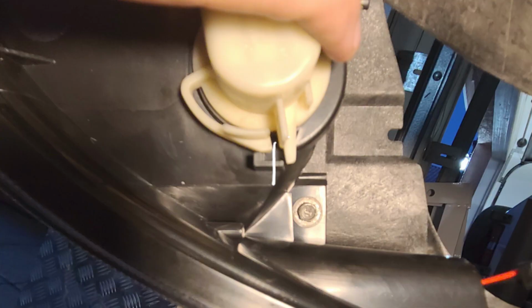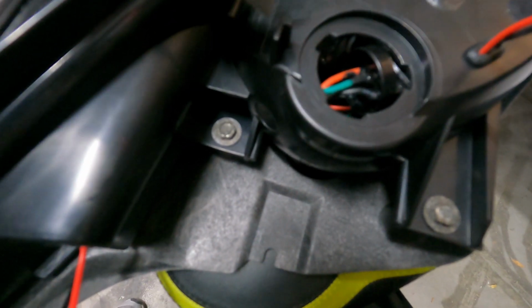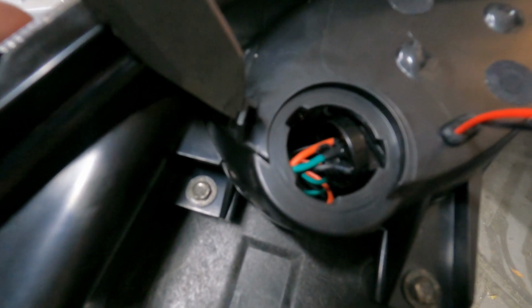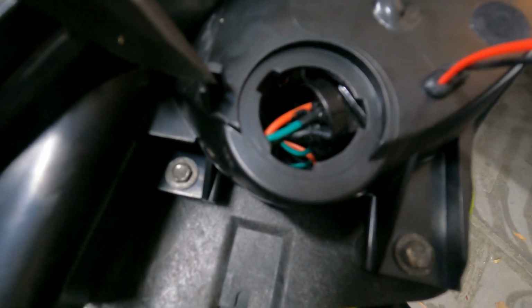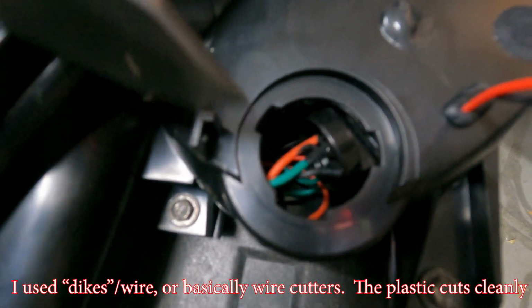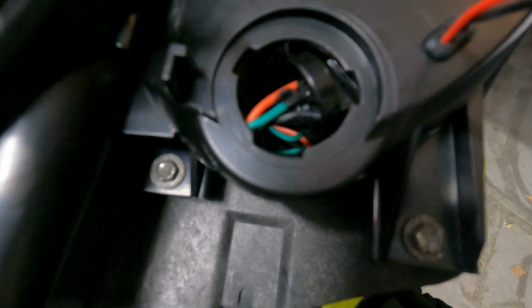So it looks like, obviously they're not going to be able to change this mold because these injection molds are done. So the fix for this is probably going to be a little mod, and you're probably going to have to cut this down probably about right here. So I'm going to do that now, and I'm going to confirm with a photo once that clicks in, but it's probably going to be about half of that. And I think what that will do is it'll allow it to rotate enough that it will engage on the back side of this right here, and you'll be good.